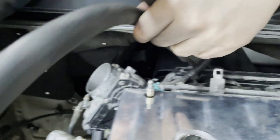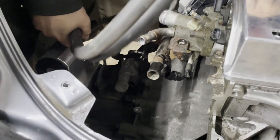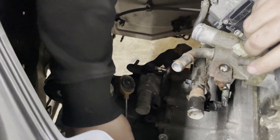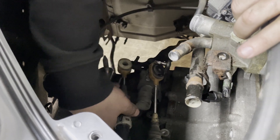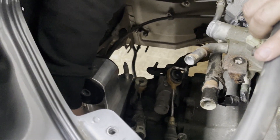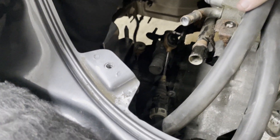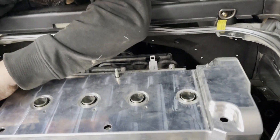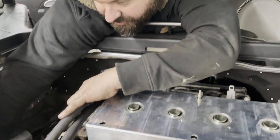One of the other things we were working on today was the shifter cables. The stock Porsche shifter cables come through the middle of the car and if we route them and kind of loop them back, we can actually connect them to the stock Honda shift selector, which is super cool. I think what we're going to do is make a little adapter so we can connect these shifter cables to the Honda shift selector, and then just a bracket to hold the cables to the transmission so they stay put, and then we don't have to do anything in the passenger compartment.